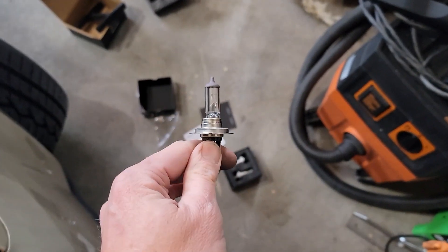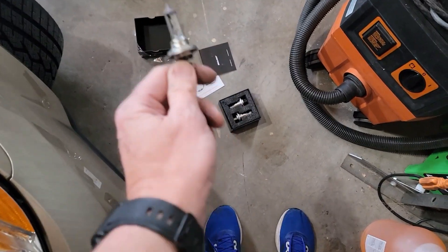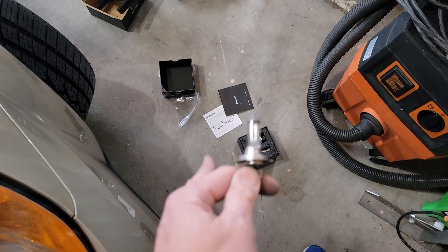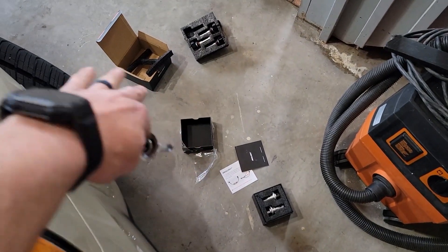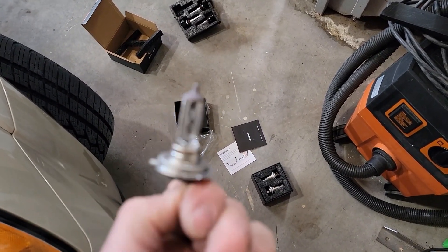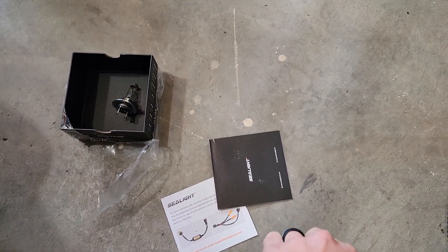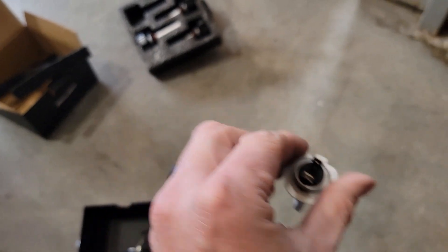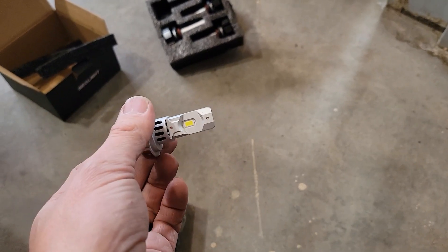This bulb is an H7. The kit is going to give you low beams and fog lamps, and you can do this install for less than a hundred bucks. If you intend on reusing this bulb, or if you have flicker and need to swap it out and send it back to get a new set, don't touch the filament at all. Sometimes Sealight will give you some little white gloves for swapping these bulbs out. As long as you don't touch it with the oils from your skin, you are good to go.